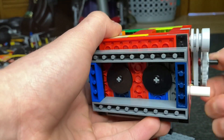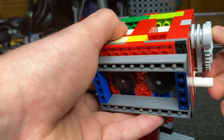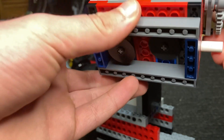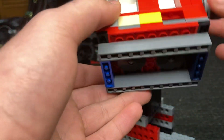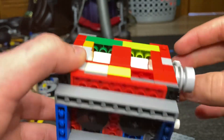This is how we actually get the valves to open and close. The exhaust valve opens when the piston is going down, then the intake valve opens as the piston is coming up. The piston is obviously sucked up and it closes just before it reaches top dead center, and then the exhaust valve opens when the piston starts to go down.